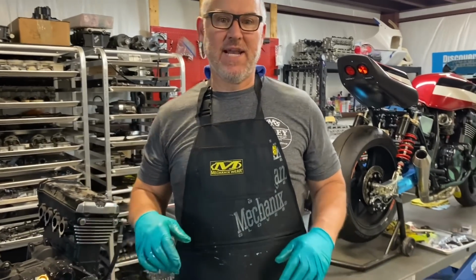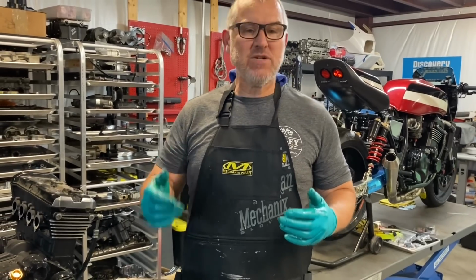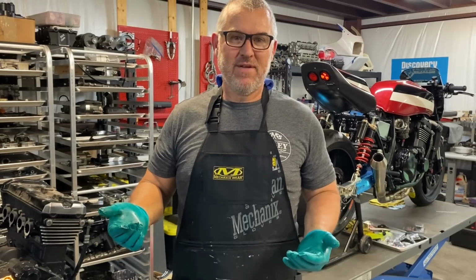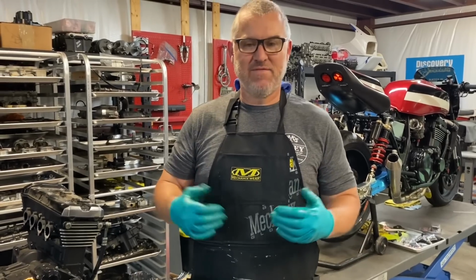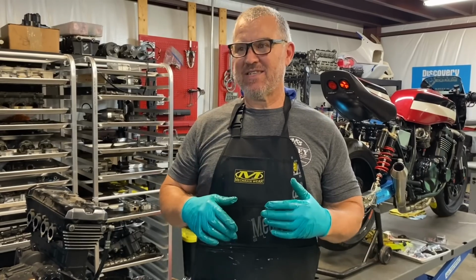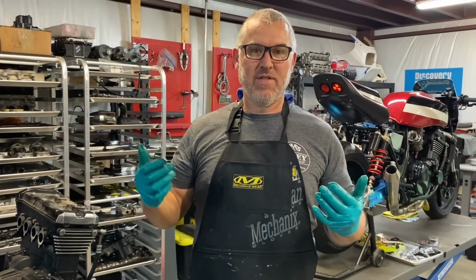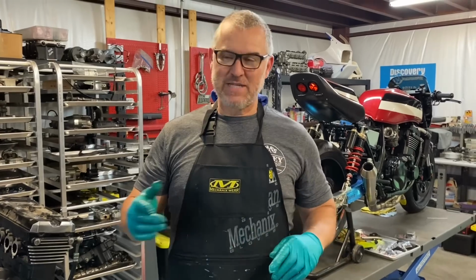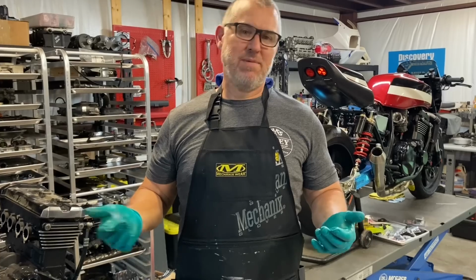We want to see if we're running into any excess wear or any potential points of failure. Because if there's any chance, we don't want to sell that to a customer and have them have the inconvenience of an engine failure. And it's bad for me, it's bad for business. So we try to thoroughly test things, and I would never recommend running open carbs on anything if I didn't have 30 plus years of experience doing it. The bikes run better, they look cooler, there's all these other factors. I do tell people, if this is your only source of transportation, maybe don't do it. Maybe put a set of filters on them.